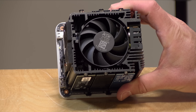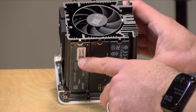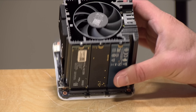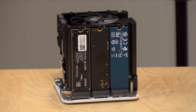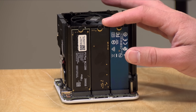What I like about the design here is that the drives go in as you see them. This is essentially the bottom of the NVMe, and the chips are touching a heat pad that then connects to the big heat sink in the middle. As you'll see in a few minutes, this device keeps my drives a lot cooler than the same drives I was using in the GMK Tech NAS — significantly cooler — so very good on the thermals, at least for the drives.